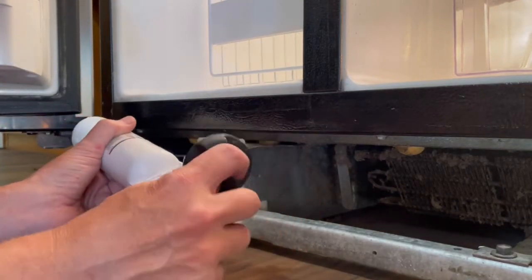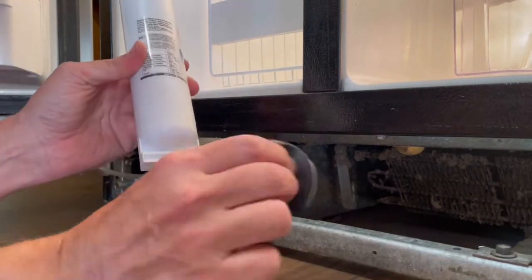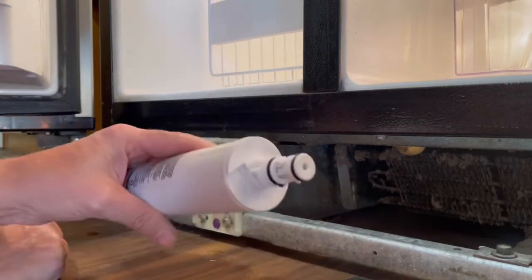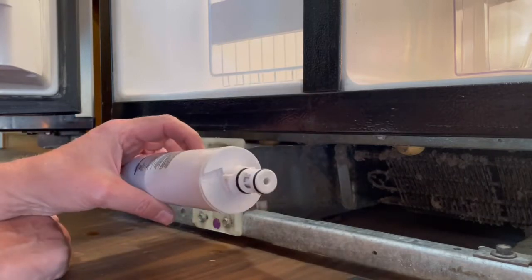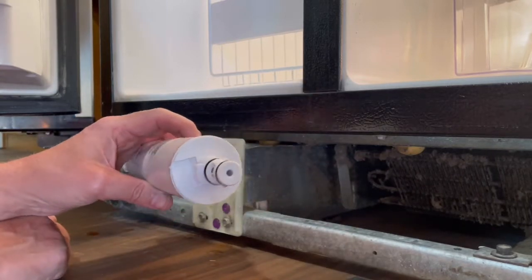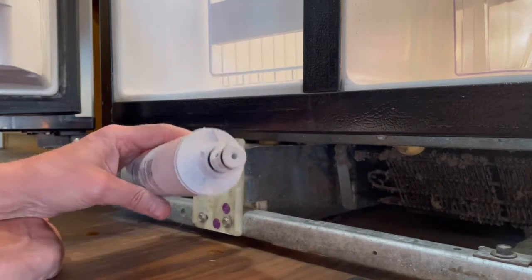This plastic part here you just slide off the end — you'll be putting it on the new filter, so the old filter can be thrown away. After about six months of use they recommend changing them. You can use your best judgment; if the water starts to taste funny, that's a sign.